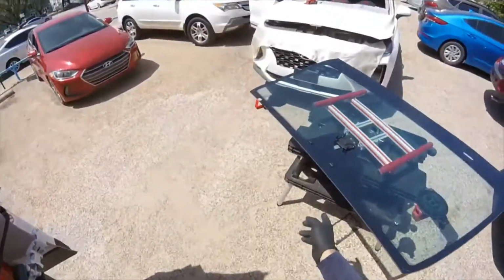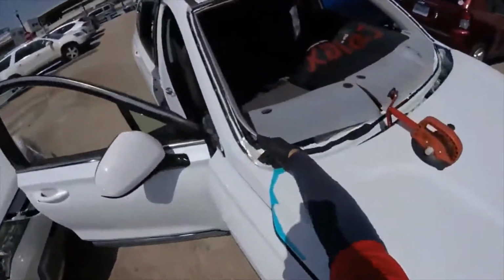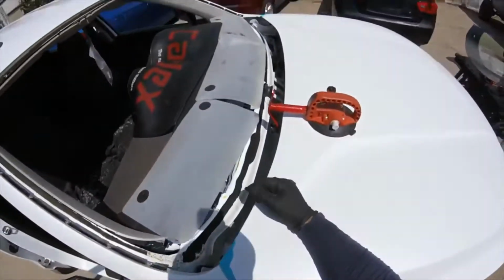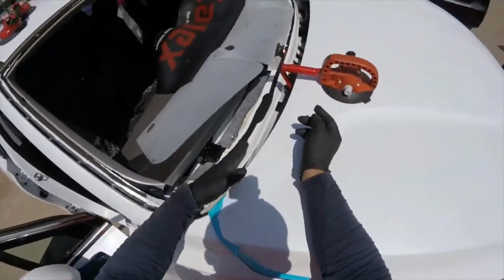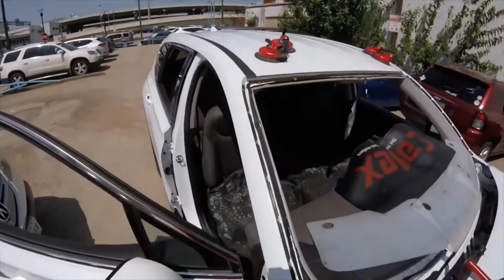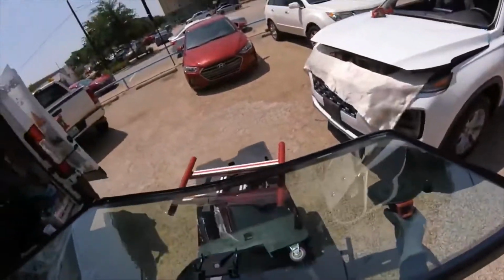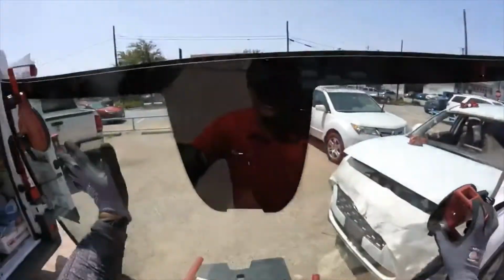I'm going to put the molding on, prime it, wait 5 minutes. I'm just going to clean here, the lamination, clean it up, and I think this one has been replaced. You see the glue? Maybe not, maybe it does. I don't see this one from the factory, but it's okay. Okay guys, so see you next shot. I'm going to just get this ready, and okay guys, we're ready to set the windshield, and we finish.